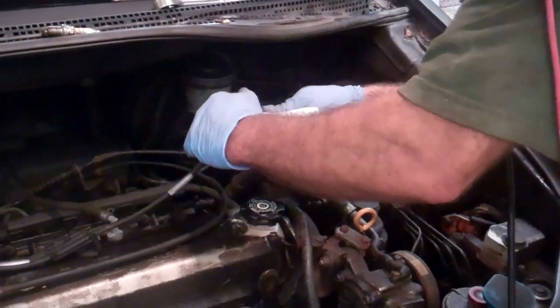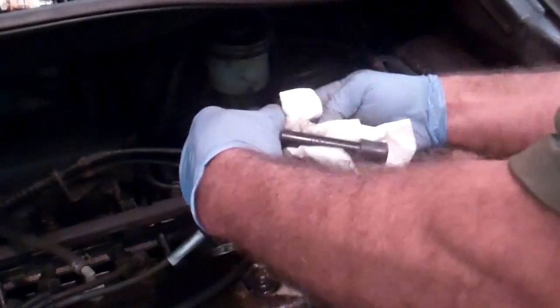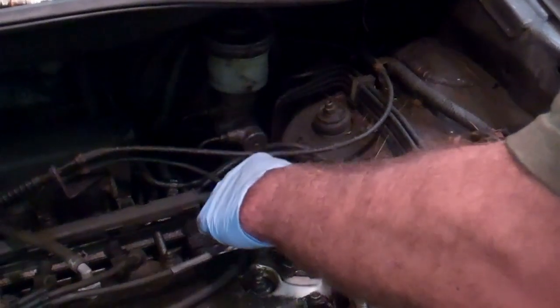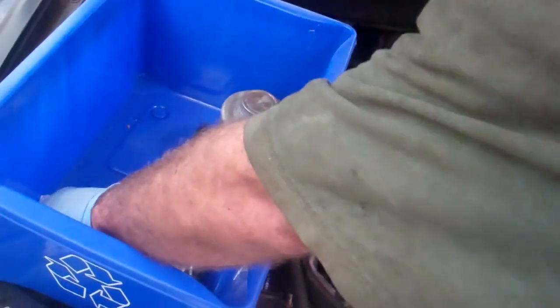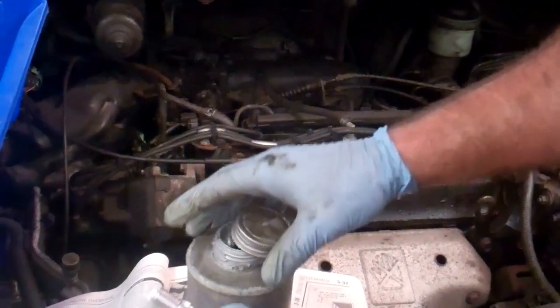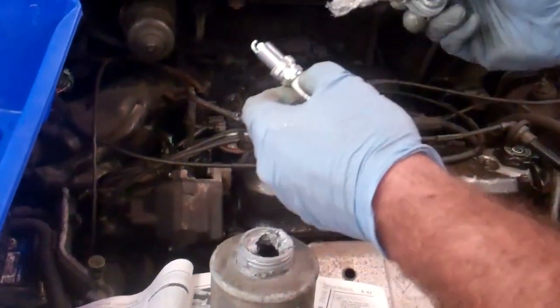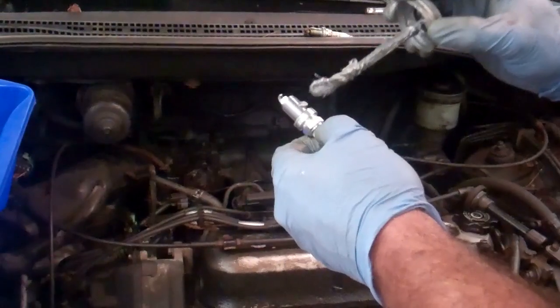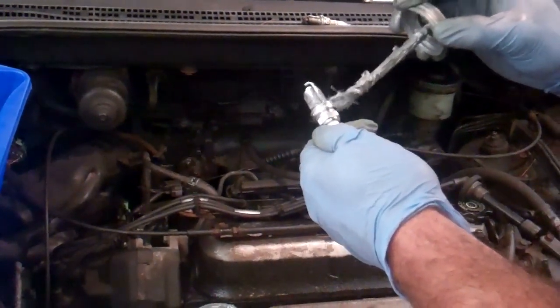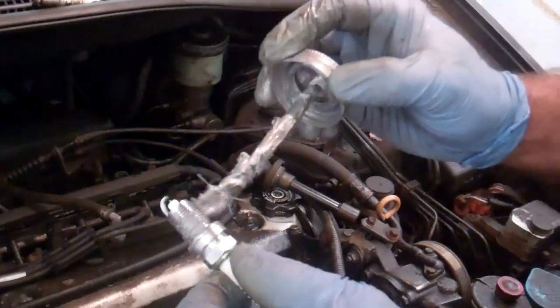Now what I do is always give the boot a little cleaning, just to get any corrosion that might be on there that could lead your spark away from the spark plug. So just clean that up a little bit. Then take a new spark plug — as per the earlier part of this video, I've already gapped them. This anti-seize compound is great. I put a bit on the thread of the plug so it'll come out easier next time, but you've got to make sure you do not get it up around the end of the plug.